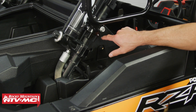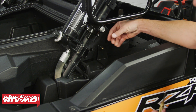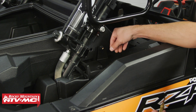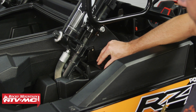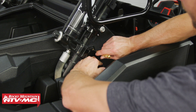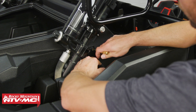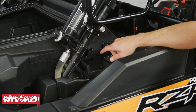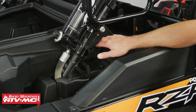For the front brackets, you need to drill two holes in the cargo box. To get to this point, you've got a mounting location right here in your bed — you're going to line up the slot in the mounting bracket with that, and just make sure it's centered up side to side. Then take a punch or a pick, go through the top mounting location in that front bracket, mark where you need to drill, and use your three-eighths or half inch drill bit to drill that out. A half inch is just going to give you a little more room to work with and adjustability.